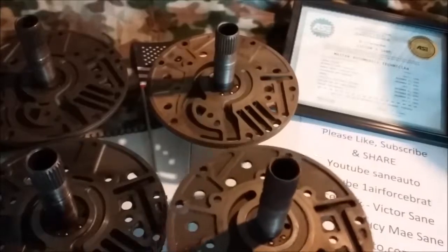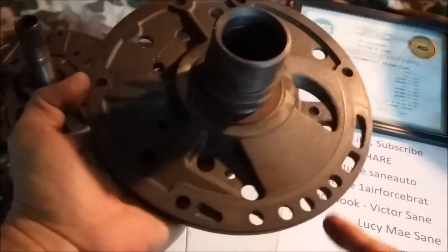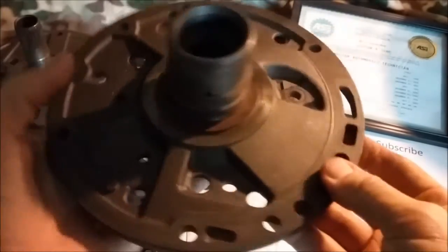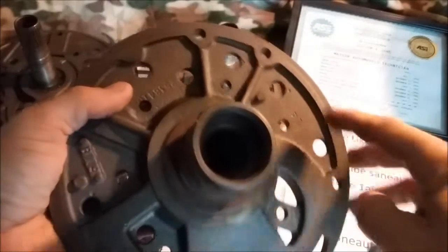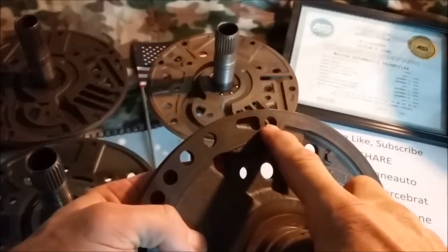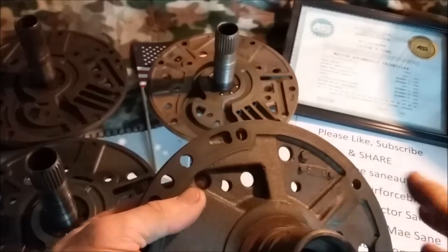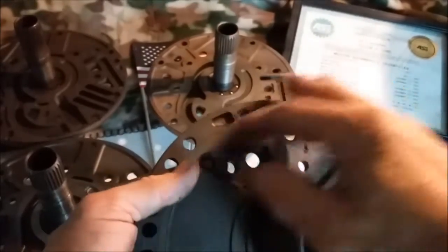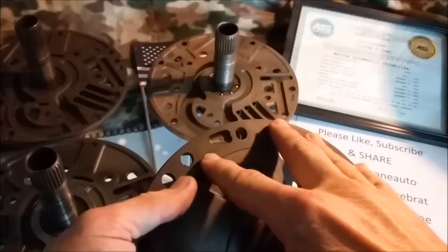What they really mean is that you have your six bolt holes, and then if you look at it from the back, you have these other holes here. If you count from here, you have twelve holes total. That makes this a 13-hole stator — and I know that sounds confusing — but what they're going off of is, even though you have 12 holes here, the gasket used between here and the case will be a 13-hole gasket for those 12 holes.